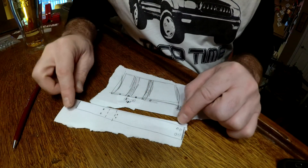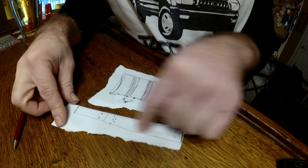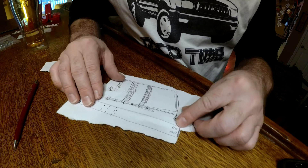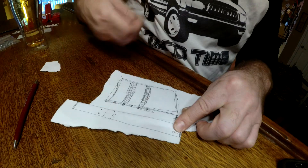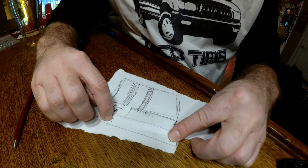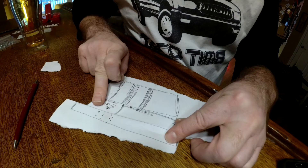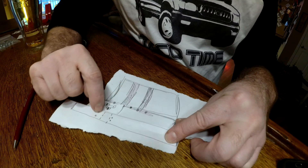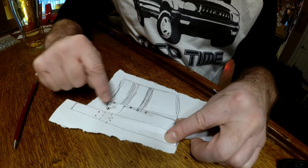You do not have any ability to adjust the rear. There are four bolts that hold the main awning bracket, and these four bolts hold it to the back. When you line that up — at least on mine — the factory holes where this bracket mounts didn't line up right. When I used the hole where the slat was and the next hole down, this bracket lined up just three-eighths of an inch away from the factory holes. I wasn't comfortable drilling holes so close, so I realized it would just fit in between two rails, and I was able to drill holes in the frame of the awning itself — well over an inch away from any factory holes.